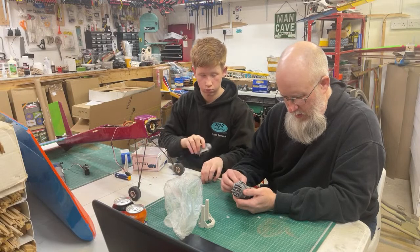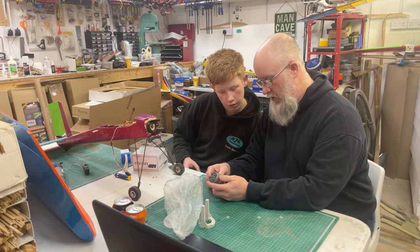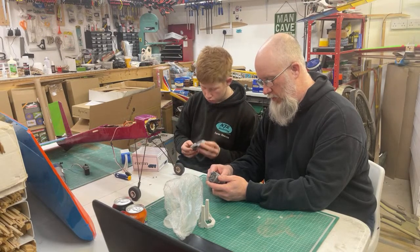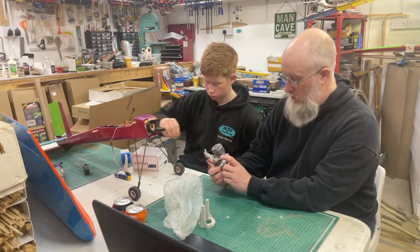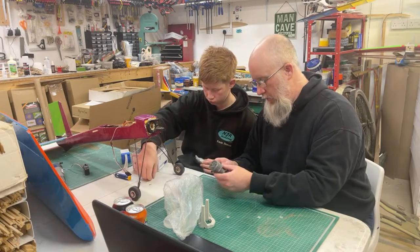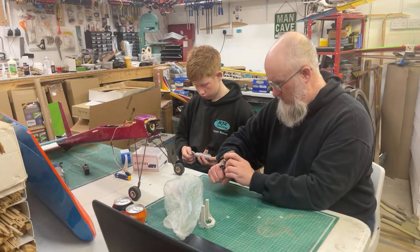And I would say it has run, because can you see, you won't be able to see, on that side of the cylinder, there's marks? Yeah, I thought that was just something else. No, there's some marks in there. There's oil marks going up and down. But if it has run, it certainly hasn't run much. There's no dirt or anything on it. There's no witness. Yeah, it has run. I reckon it has run because there's been a mark for a washer on the lugs. So it has run, but it's got silly amounts of compression, which I can't actually turn it over by.